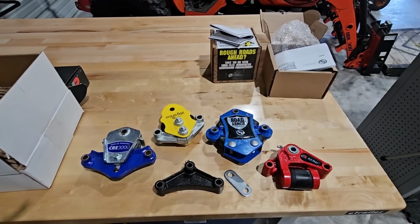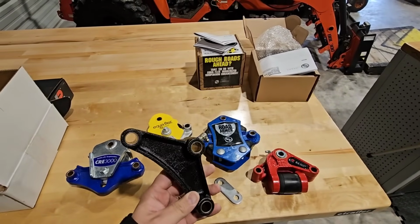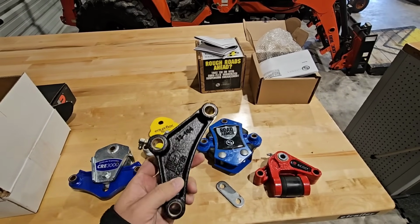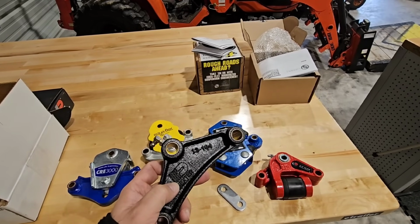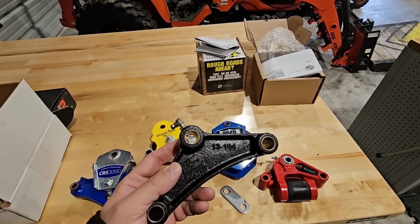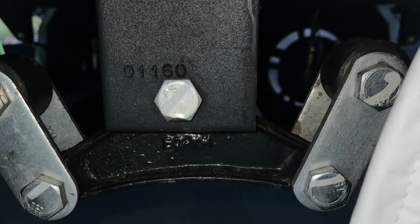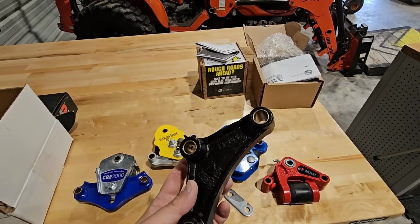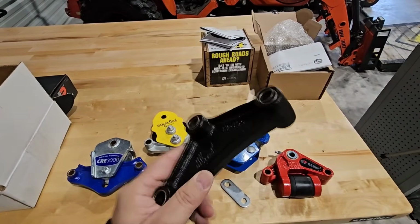The Surveyor currently has a suspension that's very similar to this. It's kind of a generic version of this. The big difference between this and the one that's on there, besides this one being made by Dexter, is the fact that this has a grease zerk at the very top of it. The OEM equalizer on the 2024 Surveyor is identical to this, other than the fact that it does not have a grease zerk.